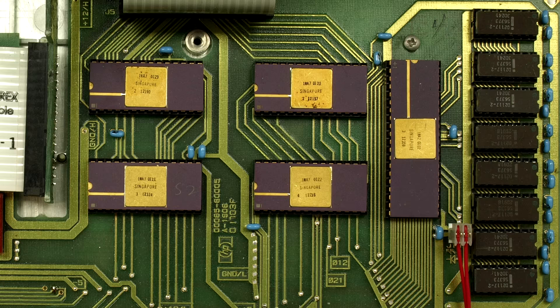We've got four ROMs here. These aren't in traditional plastic DIP packages — these are in ceramic gold, welded gold-capped ROMs. They made all these ASICs out of them. So they didn't use traditional EPROMs with a UV window, or even cheaper plastic DIP ROMs. This is obviously a mask ROM ASIC. HP had all the tools, technology, and talent to do all these ASICs in-house, so they just did. They put the ROMs in the same package as everything else. Must have cost a fortune.